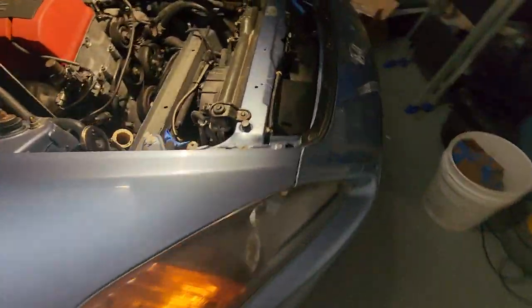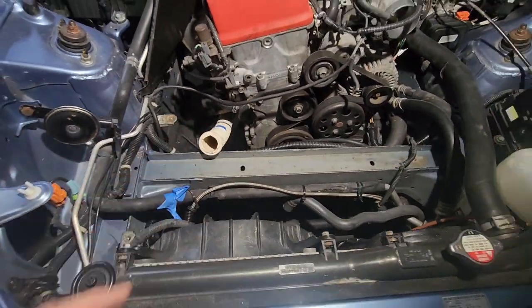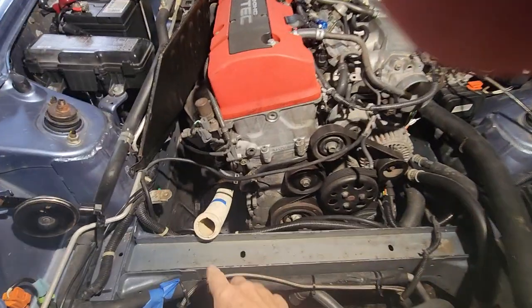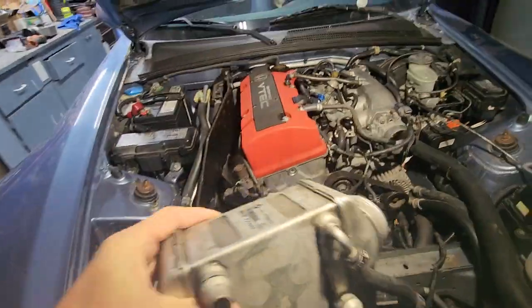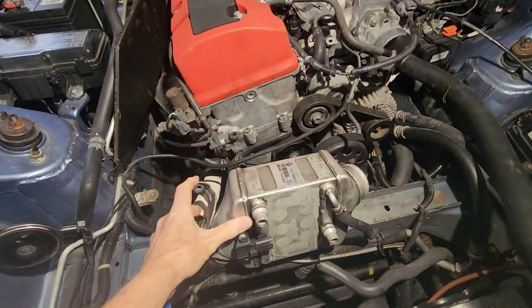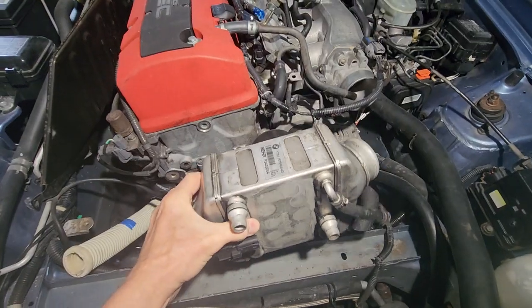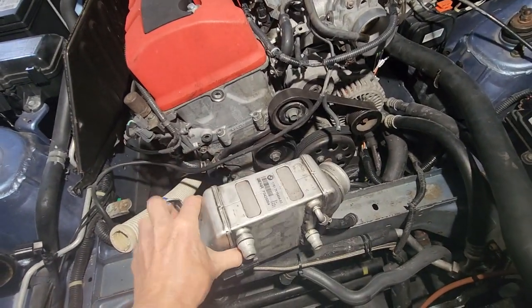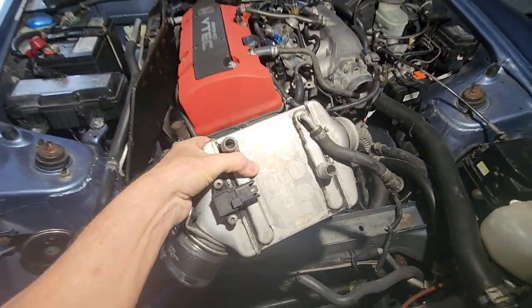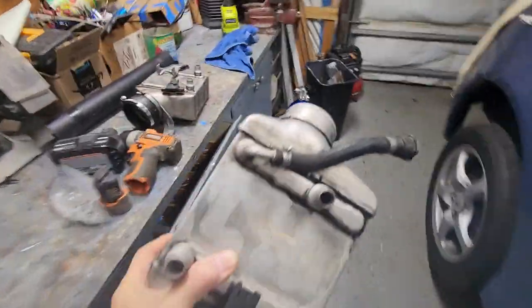Then it comes back up — I've got a piece of hose here showing where it's going to come through. It's a little tight by the steering rack, but I've got plenty of room for an intercooler. I bought a BMW intercooler off eBay — very, very cheap — and it just fits in there perfectly. It's water-to-air. My concern is it might be a little too small. I actually bought two of them, the left and the right, for $75 delivered.